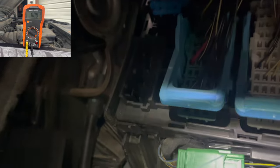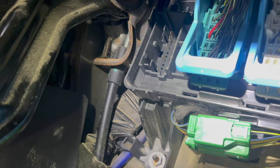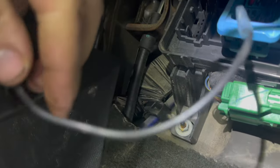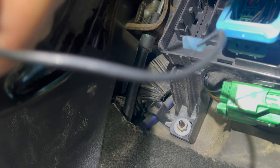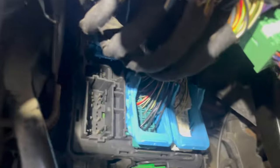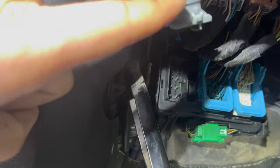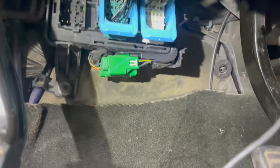All right. That dropped the amp draw right there. So I wanna figure out what this wire is right here, what they did, and so on. I want to hook everything back on, because the BCM connectors are still off, and this is the other connector from that fuse box right here. So I'm gonna take this off, see where this is coming from, put everything back on, and see what our amp draw is at now, and hopefully this is the fix.